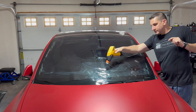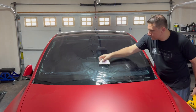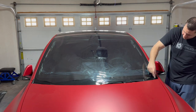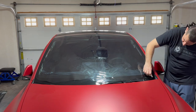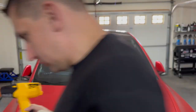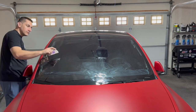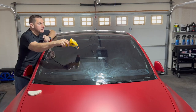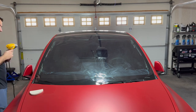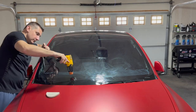This is my wife's car, so I don't want any issues — the last thing I want is to pull it off and scrape glue off the windshield. I'm going corner by corner shrinking the film, paying special attention to the corners. If the corners lift up, I lay it back down and roll that finger from horizontal back to vertical so I can shrink it. You don't want to work yourself into a corner when you're shrinking a windshield.